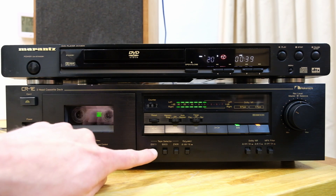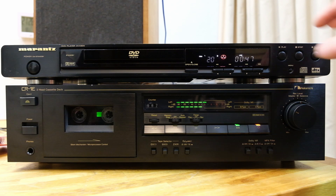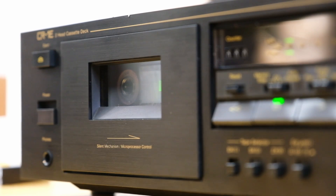The sound is coming from the output of the cassette deck directly into my computer, so you can hear that the signal is coming through nicely. We also forgot to set the tape selector to type 1 — never mind the EX, SX, ZX, that's Nakamichi-specific and you can ignore it. With levels set and ready to record, let's first make sure to wait out the tape leader — it's about five to nine seconds long and protects the tape from getting crumpled against the reel.